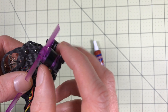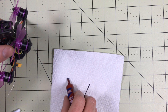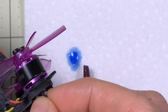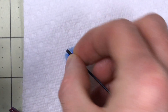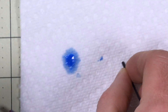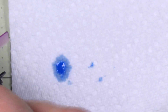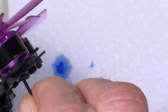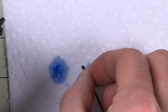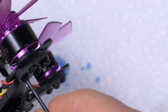But I want to try these silicone mounts, so in order to try these I'm going to need some Loctite. Loctite 242. You need less than you think - I'm just going to put a little glob here and do these one at a time. I just had these basically finger tight. See that? That is too much - you do not need that much Loctite. You basically just need enough to hold the threads a little bit. Just enough to lock the thread in place just a little bit. So I'm just going to do that with each one of these - just kind of run it through there, get the extra off, and then put it back in. And then tomorrow we'll try again.